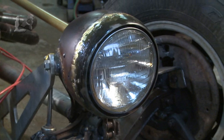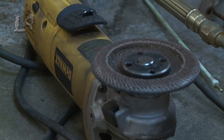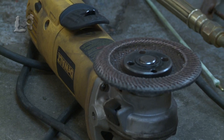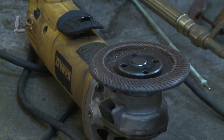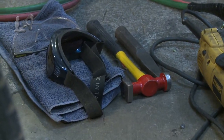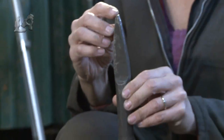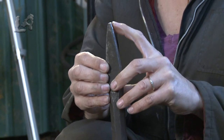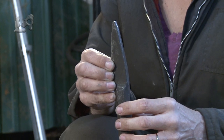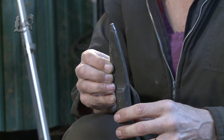What I used to get the lights like this — I used my old DeWalt grinder, which has like a million miles on it. It works great. A flap disc, which is a multi-layered sandpaper disc. To take the dents out, I used my hammer and no dolly — just the hammer to tap out the dent. I used a big center punch, kind of like a drift punch but it's got a flat wedge on it. It won't pierce the metal through when you're trying to weld on it, and it made the light contours come out just right.